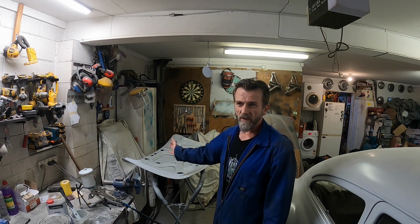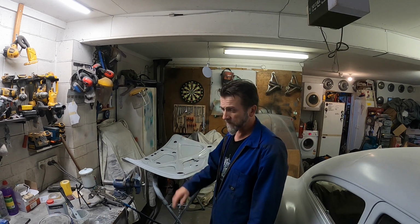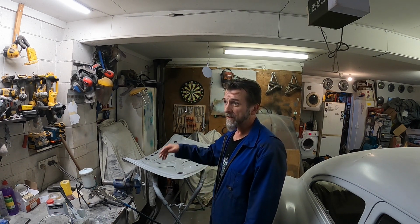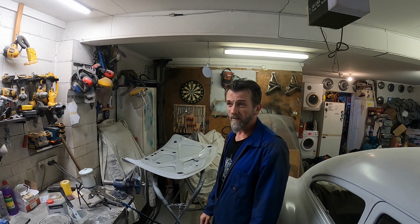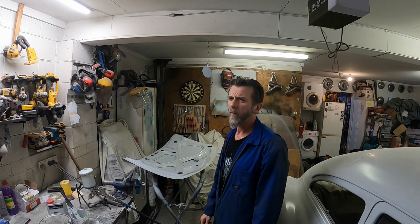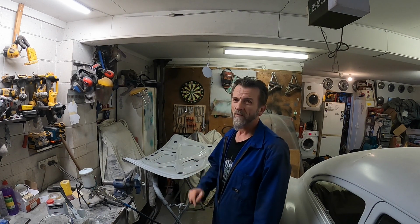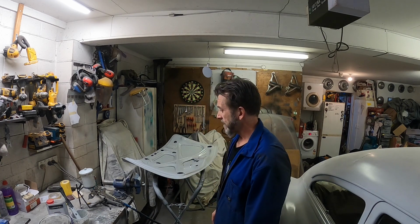But got to do 5 minutes between coats, so I'll let that flash off. Do another quick shoot over the whole thing, let that flash off, and then do one more. So 3 coats altogether. It says no more than 4 on the old TDS sheet, so we'll aim for 3 and see if I mixed up enough paint to do 3. So we'll just. Oh, it's time.